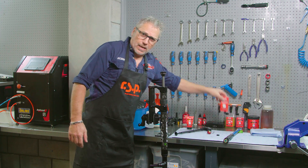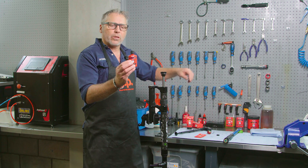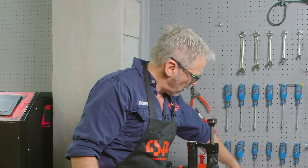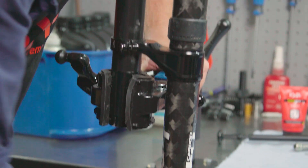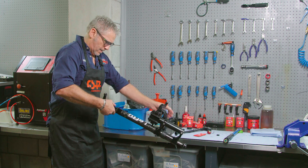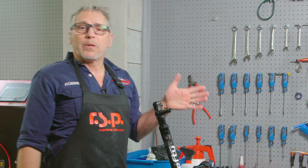I'm going to extend this all the way, open my kit, and take out the two parts that are in there. This is the 50 mils of cleaning solution — let's pour this in here. It's gone directly down to the bearings. I'm just going to cycle the fork a couple of times just to clean those bearings off, then I'm going to empty it out into my basin. Now you need to leave it to dry for about half an hour so that the cleaning solution will evaporate, then we'll put in the lefty lube and close up the fork.